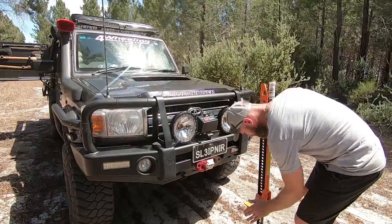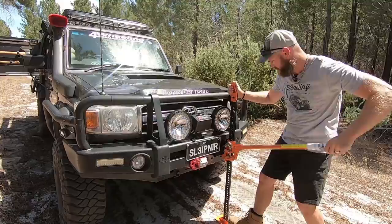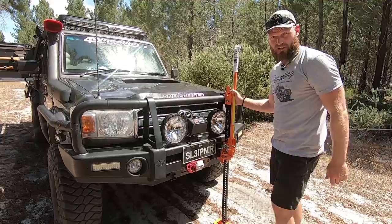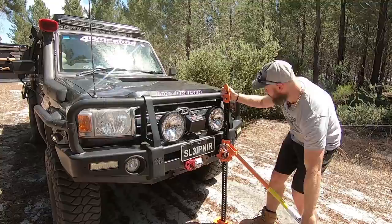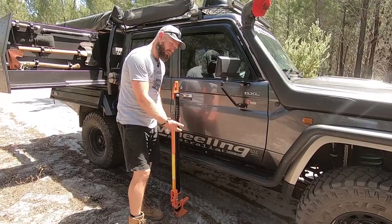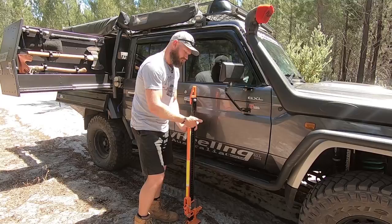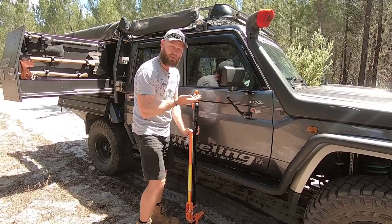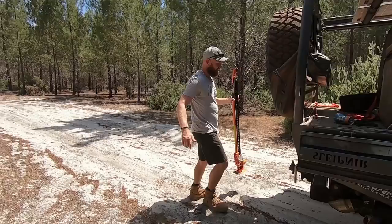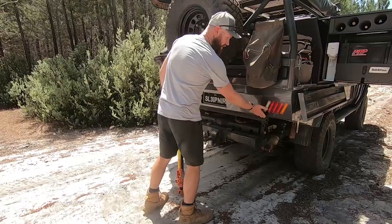So here at the cruiser, I have two points I can use — there's one, there's two. I can lift the front of the car. Looking at the side of the car, yes I can actually lift the side of the car. The thing is, I have to lift the whole suspension and everything to lift the actual tire off the ground. When we use a high lift to get the tire off, we usually dig a hole underneath the tire so we don't have to lift it as high. These are very dangerous — I've done a specific video just on this, link in the description below.